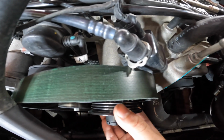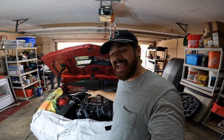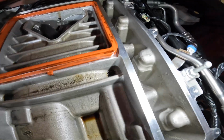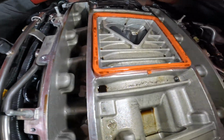The real way to tell if you do have the shot isolator is that rattling, that marble sounding when the car is running at idle. So what we did next is put some paper towels right above the shaft that leads into the engine. You want to cover those up, because if you drop that bolt in there, it is over for you.